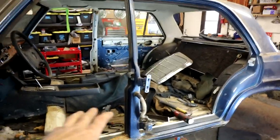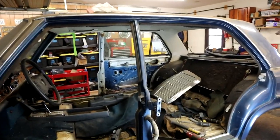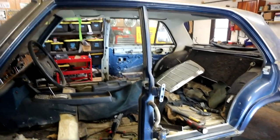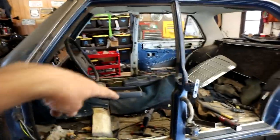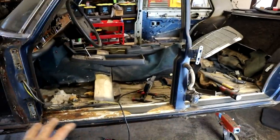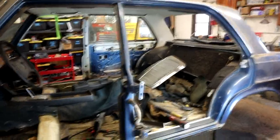I removed the two doors yesterday. Because this is a unibody we've got to make sure the car stays true and doesn't get out of alignment when repairs are made. What I may do today is weld up some plates — normally you do a crisscross in the door apertures on all four, then some connecting straps or rods going across to anchor it. That way you can safely remove larger sections without interrupting the body structure and alignment.